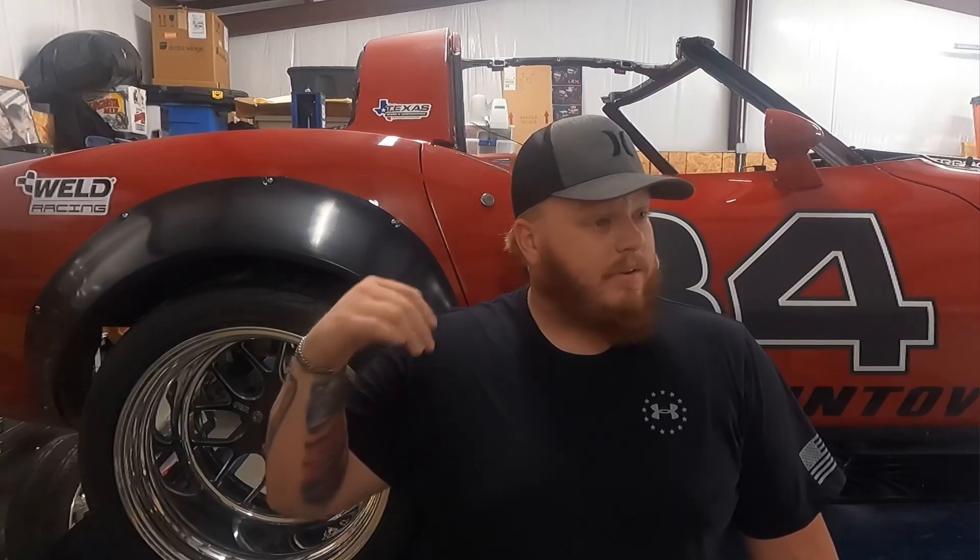That really made this car handle a whole lot better. Then later on we ended up putting parts from my 69 model — I put Van Steel lower A-arms on it, RideTech double-adjustable coilovers on the front, and SPC upper A-arms. I love those — you saw them in the 55 video. Quick adjustments, very slick. This car handles amazing. I would go out on the track in this car and then get in my C6 and it doesn't even come close in performance.